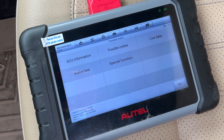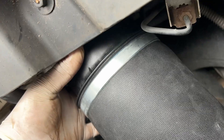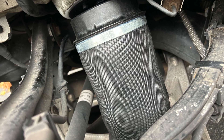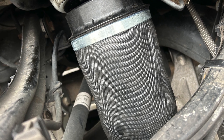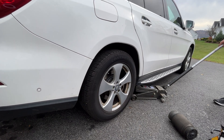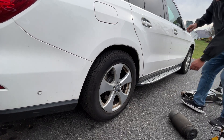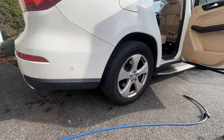You can use a jack to raise up the rear suspension and get the bottom of the spring to seat into the socket. I'm going to cheat a little and use a scan tool to go into the test menu and throw some air into the spring — you can see the bottom part popped out and seated down into the socket. If you don't have that tool, slowly lower your vehicle onto the spring. Once the car turns on, it'll fill with air and level out.